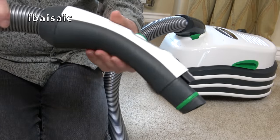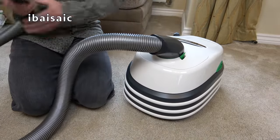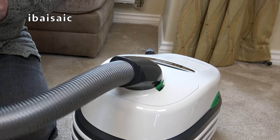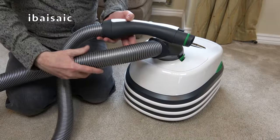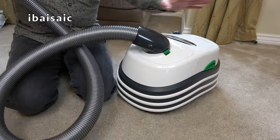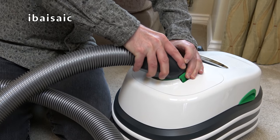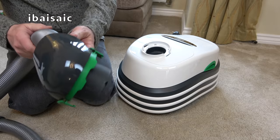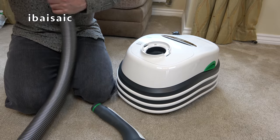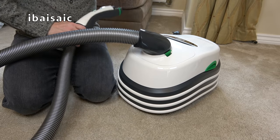The hand grip rotates to prevent the hose from becoming tangled, and the hose is tapered — narrow at the handle end and quite thick at the cleaner end. Despite being a power hose it rotates 360 degrees, so although it's very bulky at the cleaner end it's not too inconvenient. The cleaner is on casters and moves in all directions. To remove the hose, squeeze the two little green tabs either side — the hose comes off and you can see the electrical connectors. It only goes in one way; line up the connector and push until it clicks.